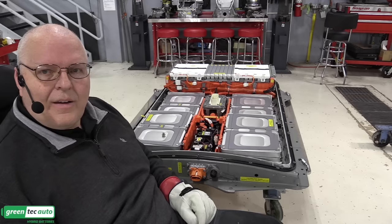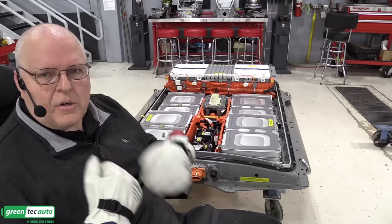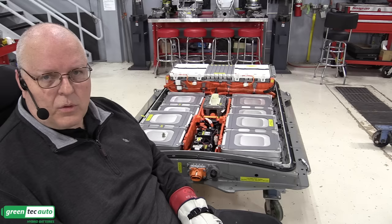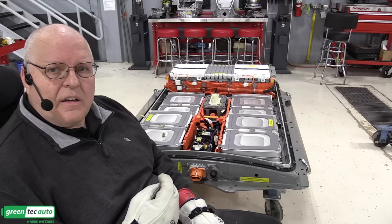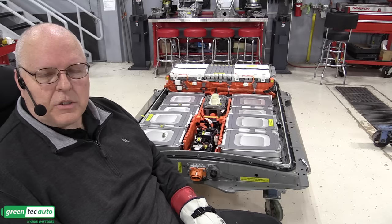All right, this has been a really long video, a big long service procedure of putting one of these back together. Almost anybody can take one apart. Big deal. Just take the bolts out and start pulling and tearing and so on. But putting it back together and having it work when you're done is a different story. And it's critical that you follow proper service information and torque bolts, especially the electrical connection, bus bar and cable bolts, so that we don't get any poor connections which end up causing unwanted resistance and unwanted heat, melted connections, possible fires, and so on.